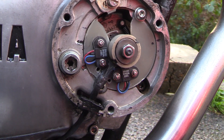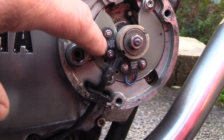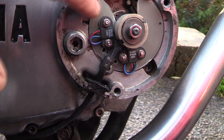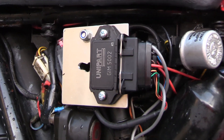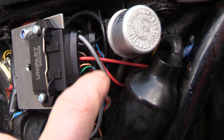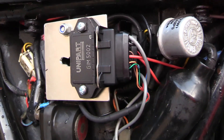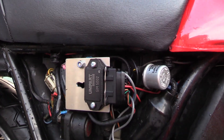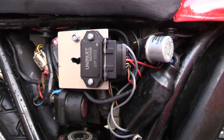If it were a 360-degree crank — where the pistons come up and down together — they would be 180 degrees offset from each other. The Hall effect sensors are mounted on a piece of fibreglass, which is even better as these sensors can handle up to 110 degrees temperature and it gets to about 85–90°C in there. The modules are mounted here behind the side panel — you'll probably recognise them if you've worked on old cars. There are two electronic ignition modules powering the coils. Wiring from the Hall effect sensors connects in here: you've got a ground lead, two wires going to the coil, and a spare pin seven connection if you want to add an electronic rev counter. The flasher relay will need to be relocated — I'll extend the wires and mount it under the seat or back here.